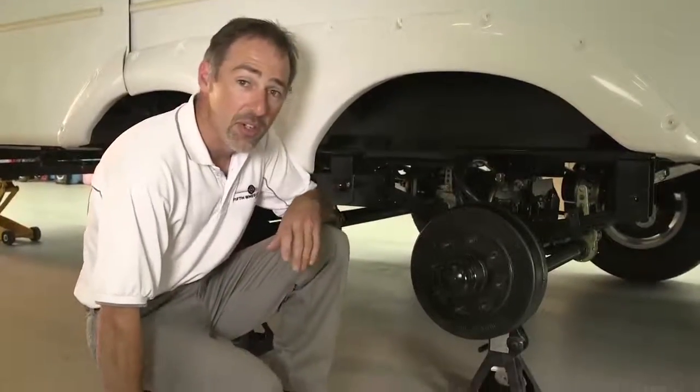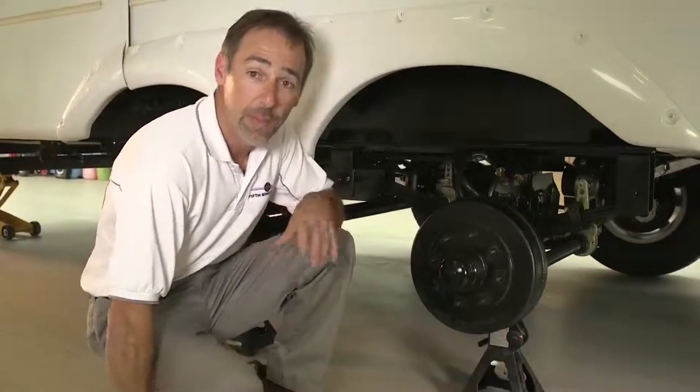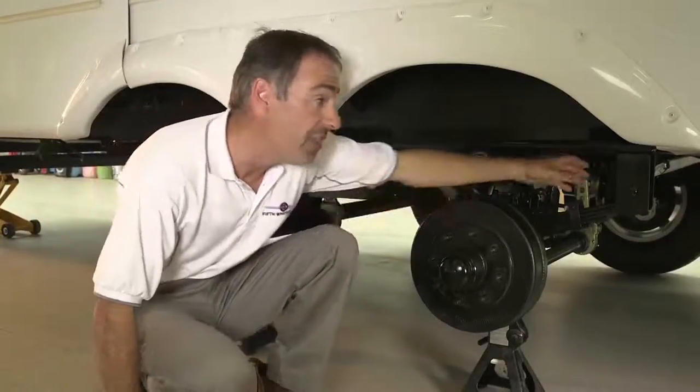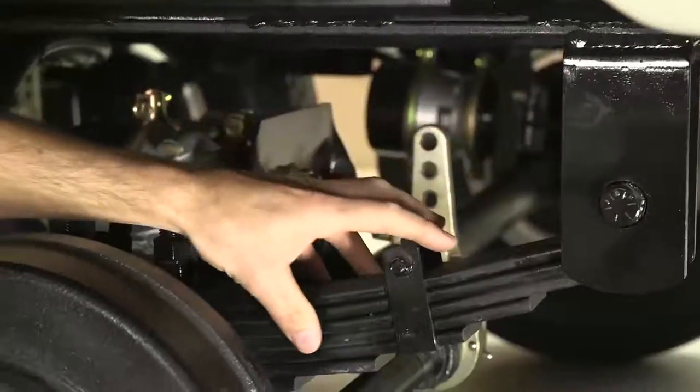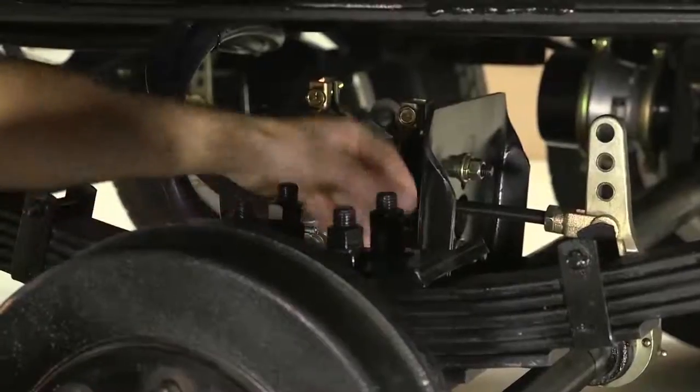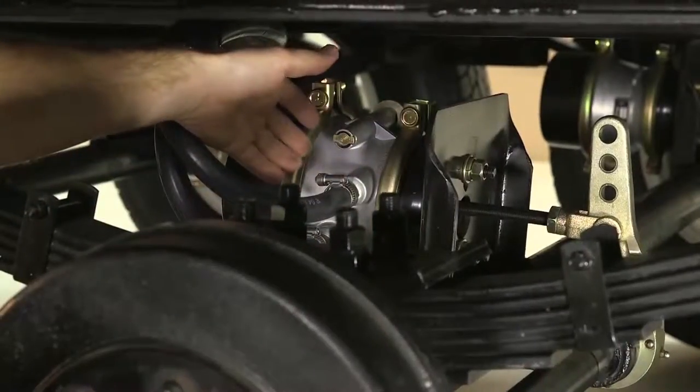The first thing we do is remove the standard electric brake axles and prepare the chassis for the new sub-assembly. We weld on heavy duty hangers, we put 7 leaf springs in and a solid 65mm axle with S-cam brakes, the same as you'd find on a normal semi-trailer.